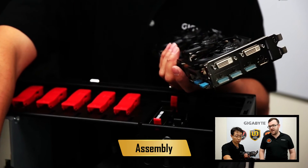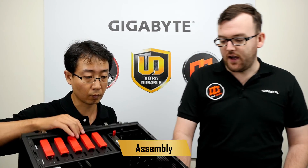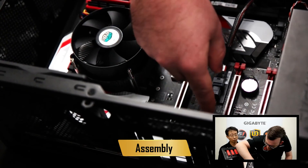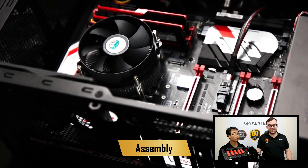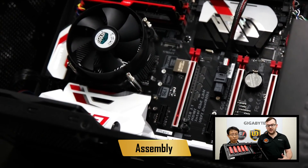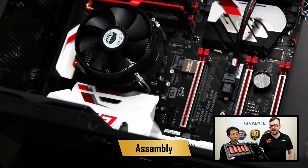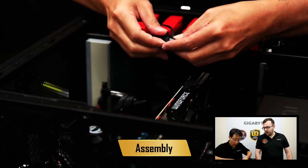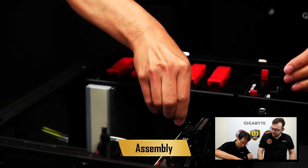It's time to install the VGA card. You can't just install the VGA card in any PCIe slot. If you look closely at the board, each PCIe slot actually has a number by it — in this case we have X16, X8, and X4 — which shows what PCIe lanes are available. You want to make sure your graphics card is in the highest slot possible to have the most lanes available, giving you the most bandwidth to your card. We're going to use the X16 PCIe slot. VGA cards also need power themselves, so we have a power connector that we have to connect the power cables to.